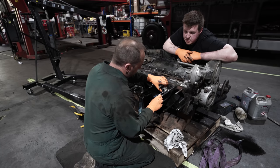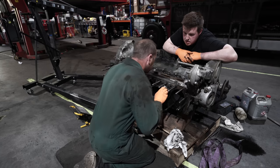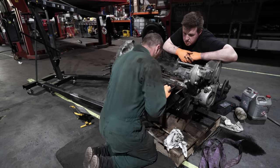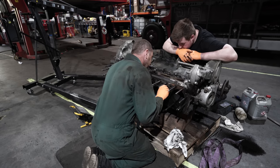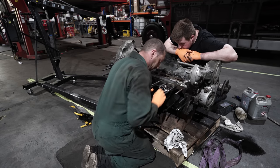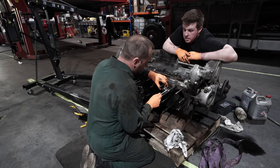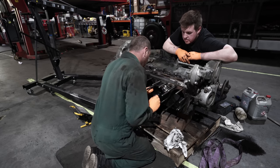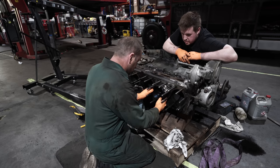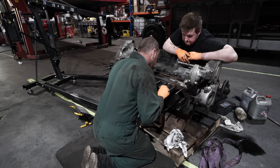The reason LT only went with three is because they didn't want them glazing up, and because they sit around a lot, bus engines, because they're doing very little work, they deemed that they didn't need five rings, they only needed three. So to prevent glazing up, they also have thinner rings. On a Routemaster engine, they're three ring pistons with a thinner ring, but all 690s and 590s that are for any other application, pretty much a five ring piston.